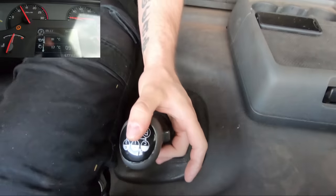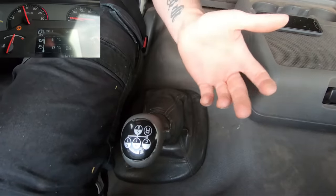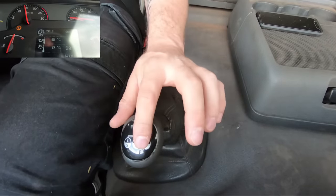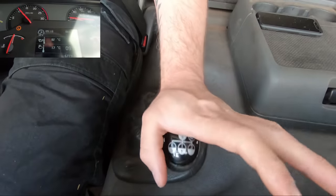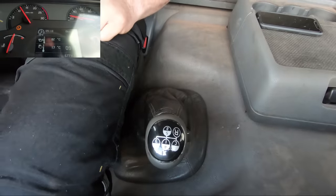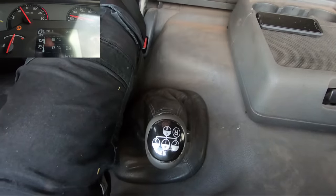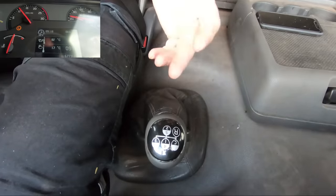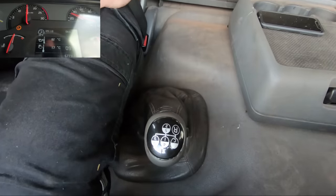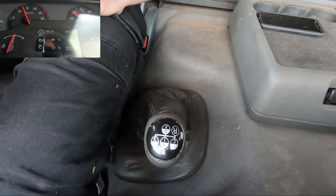Now we're going to put it up to high range, ready for when we change. If you don't double clutch when you change from third to fourth it gets rough — that's why I double clutch. If you do use one of these gearboxes I would advise using the splitter and getting used to it while you're empty. We'll get it up to 1500, press the splitter up, dump the clutch, and press it down ready for fifth gear.